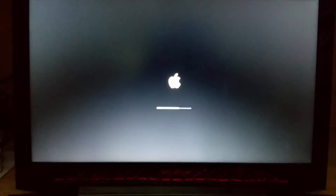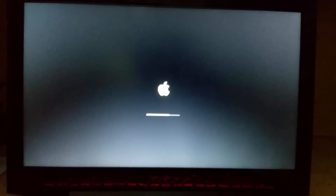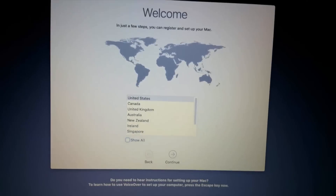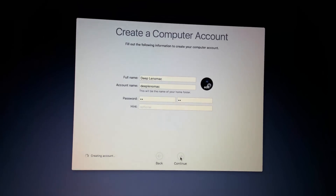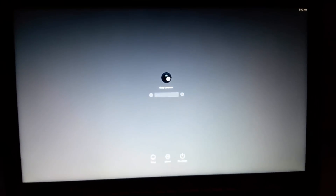You've successfully installed and configured a dual-boot system on your Lenovo Y50 where you can boot into Windows and Mac OS X El Capitan without any issue. You may still encounter the graphics glitch — just press Fn+F1 to fix it. Once booted you'll get the traditional Mac setup screens. This is part one of the series on how to install El Capitan on the Lenovo Y50. The series will have a maximum of two to three parts — in the next part I'll cover configuring drivers, sound, graphics, and power management to get your Y50 running at full performance.